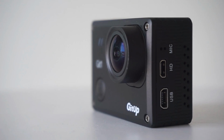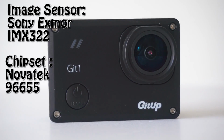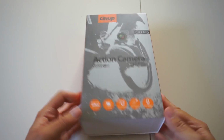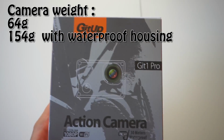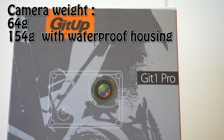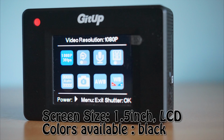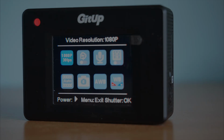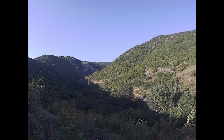The camera has a Sony image sensor and Novatek chipset. The fact that they included a Sony sensor speaks a lot about the quality they are striving for. The camera weighs around 64 grams with a battery inside and around 154 when put in the waterproof housing. It has a 1.5 inch LCD screen on the back and can record videos in 1080p 30 frames per second, as well as take 12 megapixel images.